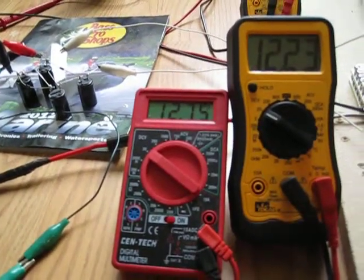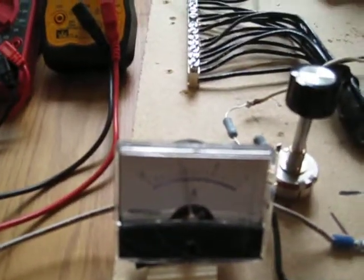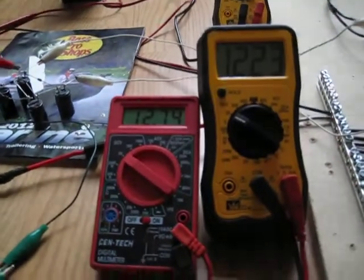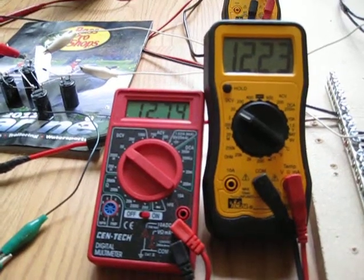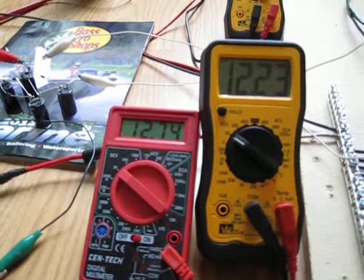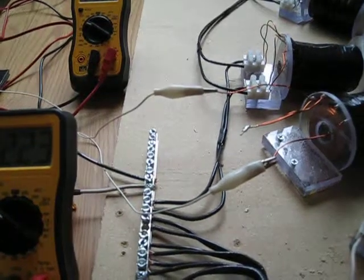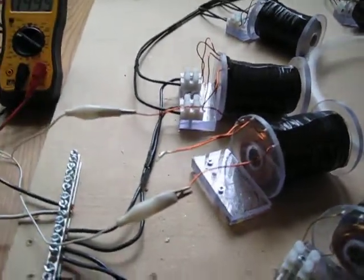It's reading 12.75. We're just slightly over 1 amp on the drop of the battery. And the battery is being charged at 14.96. This is just to help supplement the run battery. And Doug was sitting there saying that I could hook up other batteries and charge them off the circuit — just use this one extra run coil.